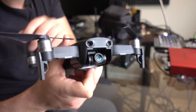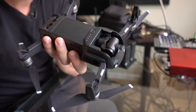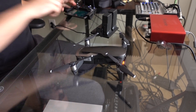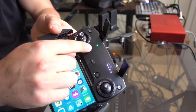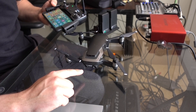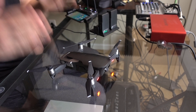Now, let's power on the Mavic Air. Flip it over, and there's our little battery power button — press it once, and then again and hold it, just like the remote. Flip this back over and put it on a flat surface. You heard the chime. You'll see in the back we have a yellow blinking light. Our remote just turned green, which means we are good to go with our connection from the remote to the drone. Our lights on the front are on, and our gimbal is now acting properly. We just heard a fan kick on — there is an internal cooling fan which keeps it nice and cool if it's working too hard.